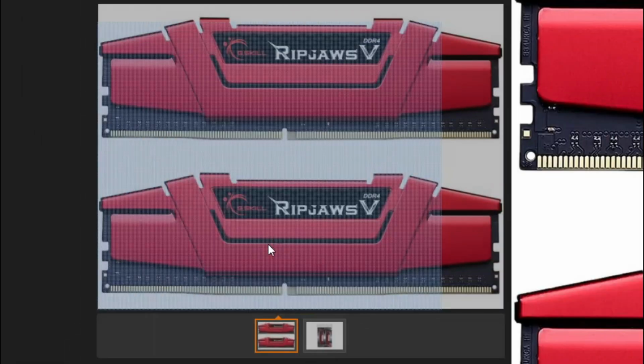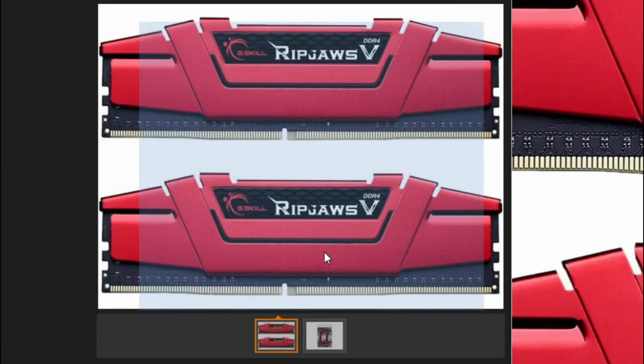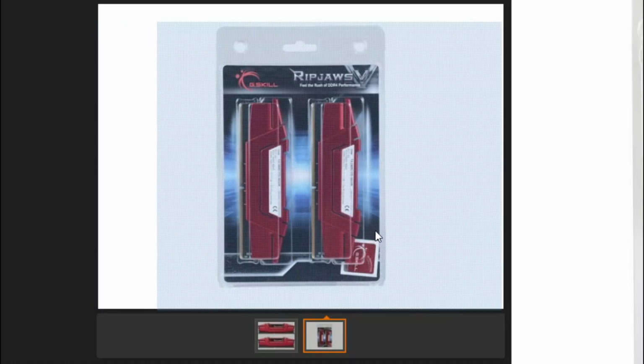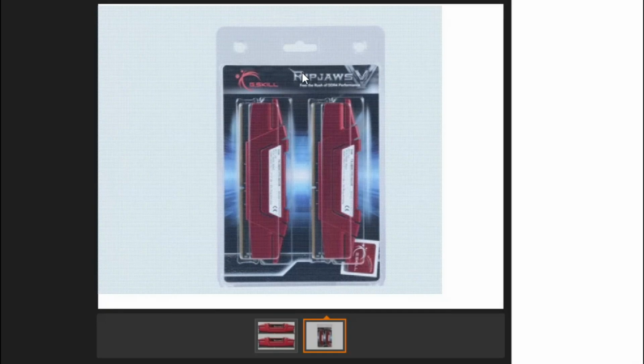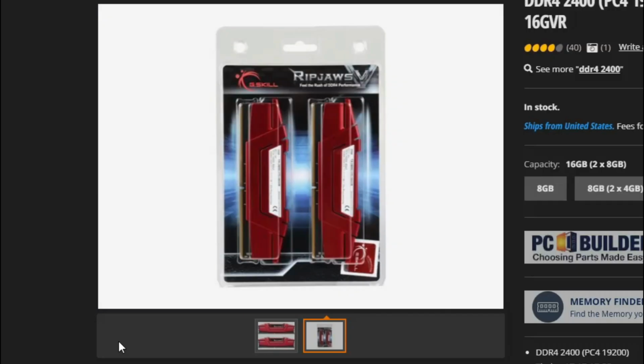Now for the RAM, I forgot to record a footage for it, so here. I got a kit of Ripjaw 16GB clocked at 2400 MHz DDR4 memory for only $60 off of Facebook. I managed to overclock this kit of memory to 3200 MHz at CL16. I overclocked it to 3200 MHz because it is the sweet spot for Ryzen 2nd gen CPUs.